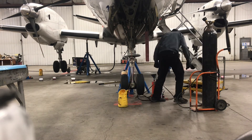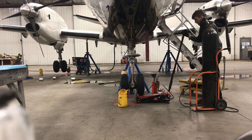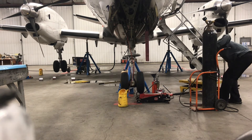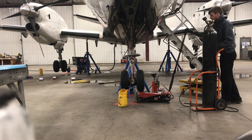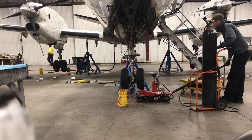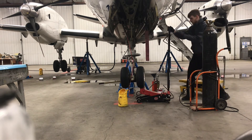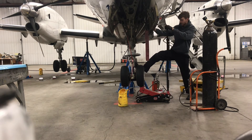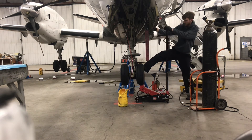It's starting to get a little cold — somebody opened the door, so I had to put on my sweatshirt. With the plug back in and our tire holder broken — which is a tool we usually use for this — I just ended up using this floor jack. With one drain open, or cracked anyway, with my hose hooked up to it, you then compress the strut completely, which expels most of the fluid but not all. You want to go up slowly so as not to blow off your drain line, because you're compressing all that fluid in there.